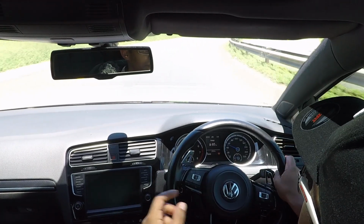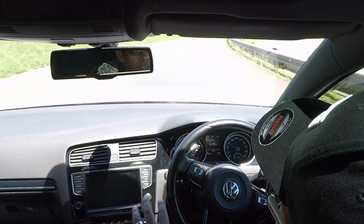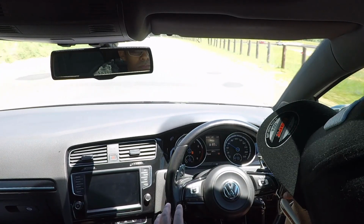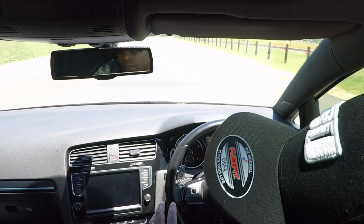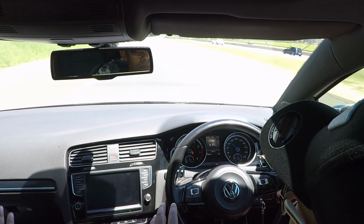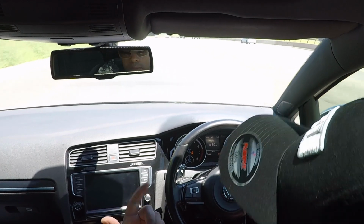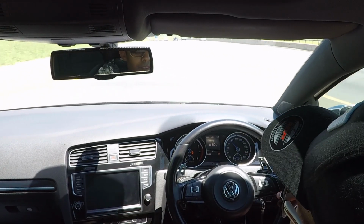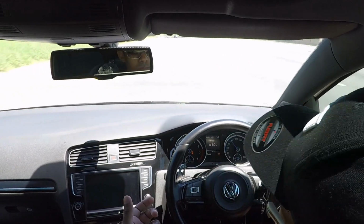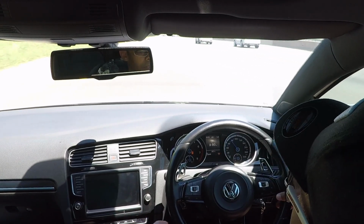That brings me to the other thing I wanted to talk about. This is a bigger turbo, but it's straight bolt on. It comes with a turbo and the inlet pipe, and it bolts onto your factory everything: your factory downpipe, oil and water lines, and the factory manifold. So it's stock motor, stock clutch. You bolt on the turbo, do a full turbo-back exhaust, and run water meth as well, and your cooler.